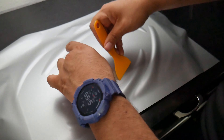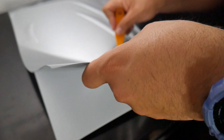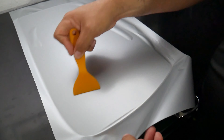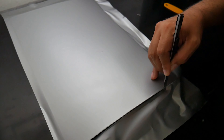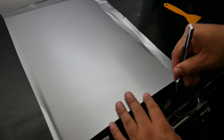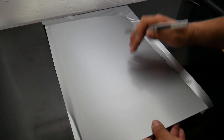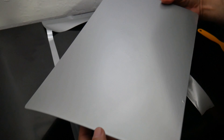Just be sure the plates are clean and free of dust before the installation. I start from the center and use a hand tool to remove all the air bubbles. If they persist you can pull the vinyl and repeat the application. This can take several attempts, so don't get frustrated if you didn't get it right the first time. Now you can start cutting the excessive vinyl with the knife around the plates. I also check for air bubbles and pop them with the knife as well — sometimes the bubbles just won't leave, so you can repeat this step until you're satisfied.